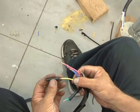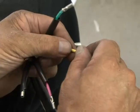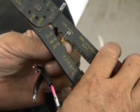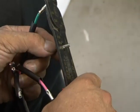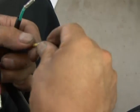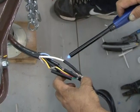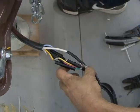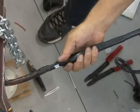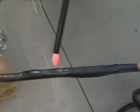Place one section of shrink tubing over each of the seven wires prior to making any connections. Match up each of the wires and pair by pair place the stripped ends into opposite sides of an electrical butt connector. Use the larger butt connectors for the larger diameter wires. Crimp the connector making a good connection and pull test to ensure its integrity. Another option is to solder the wires together. After all of the wires are connected and crimped, slide each of the small heat shrink tubes back over the connections and apply heat to the tubing. Slide the large heat shrink tubing back over the entire connection covering all the connected wires. Apply heat until the tubing has shrunk around all of the wire connections forming a watertight seal.